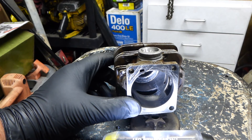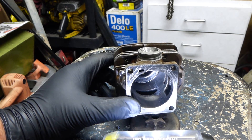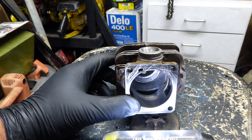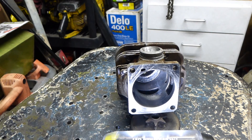Now you've just got that one vein of aluminum left. Think of it like washing dishes - sometimes you've got to let it soak a little more, scrub a little bit, let it soak, back and forth until you start getting it clean. The slower you do this process the better. The best way I've learned to tell when the cylinder is hot enough is when the water evaporates off it from the last wash. This will probably take me about two or three more cycles of acid treatment - I'll go ahead and do it and report back.